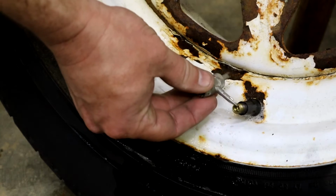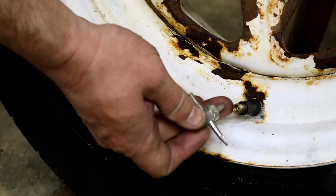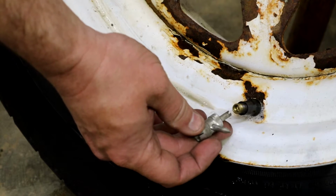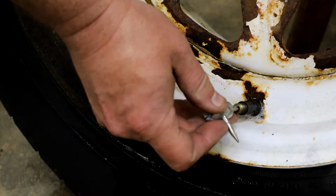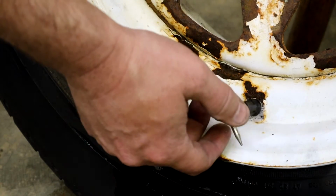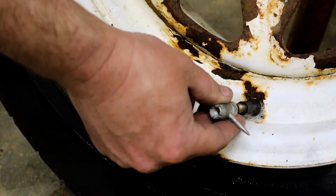Now this is the little valve core tool. You can get most of your parts houses or online on Amazon or anything. I'll link in the description on where to find one. I'm going to loosen it just a little bit so I can simulate that it's leaking, so you can see with the soapy water.